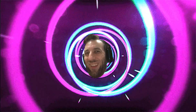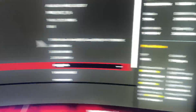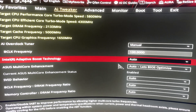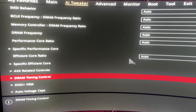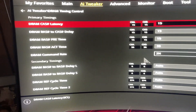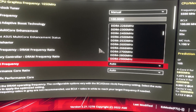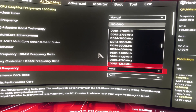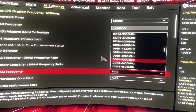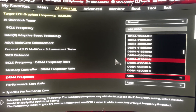Let's see if there is any performance benefit to going with the Z790 DDR4 motherboard. We're starting with the Z690 Strix and 4x8 first. I'm going to go manual and set timings to 19 because we're not focused on timings today — we're focused on maximum frequency. I'll start at 4,000 and step up one bin at a time until it stops posting, then back off one and validate in Windows.